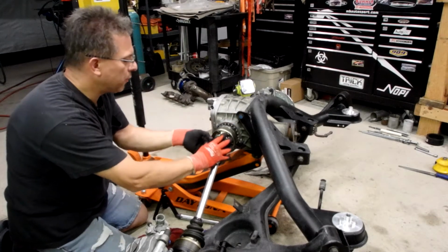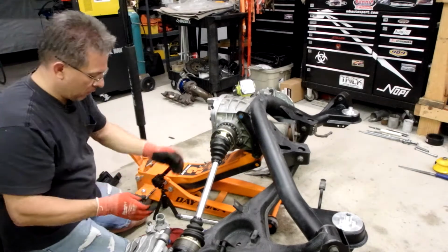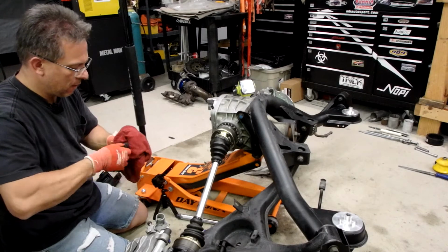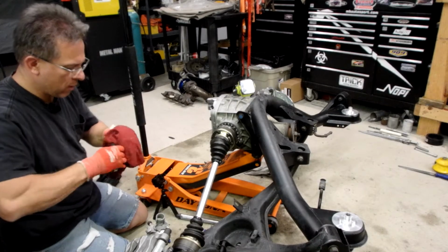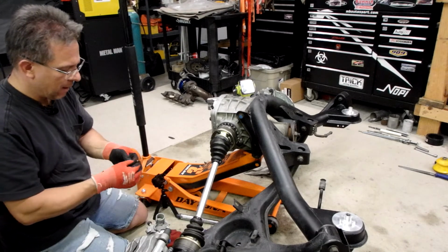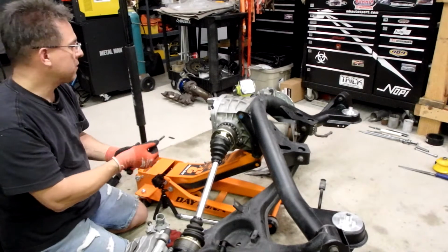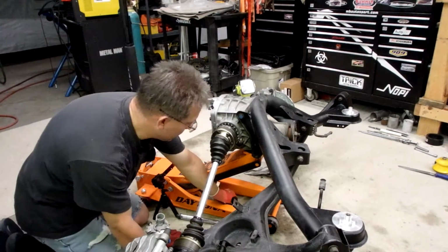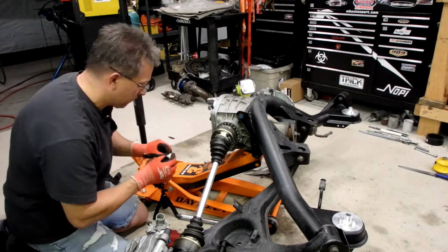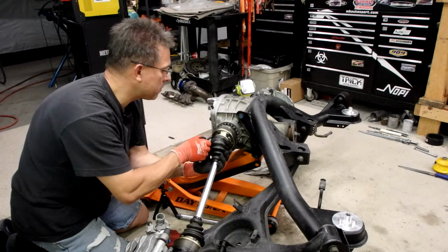But what you can do, if you ever are doing maintenance back here, or you have an axle that's failed and you need to get those factory Torx bolts out, go ahead and throw them damn things in the trash. And there's a number of guys that supply, I mean, not that you couldn't source them yourself, but there's a number of the suppliers that have put together axle bolt kits with Allen bolts. So these are a lot better to deal with than those Torx head bolts.